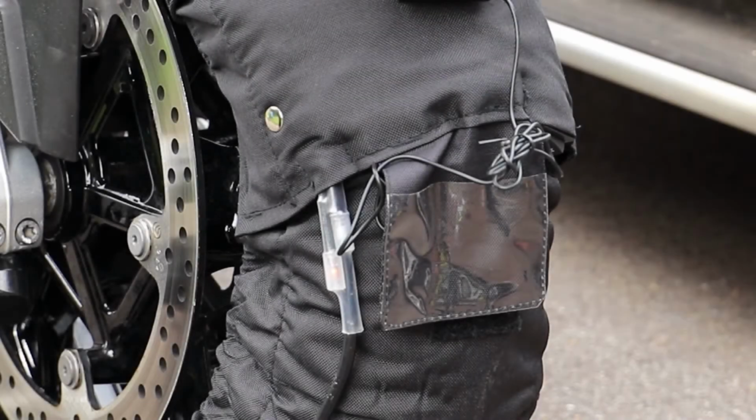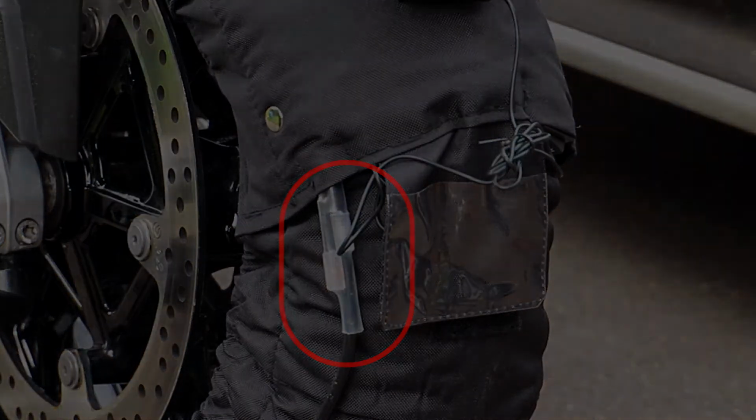In terms of operation, it's worth noting that where the cable connects into the tyre warmer, there are a couple of LEDs. Red indicates that power is on and heat is being applied, and green, of course, that power is off, meaning that the tyre should have reached its temperature. Of course, as the temperature drops back down, the warmer will switch back on again. Unfortunately, due to the bright sunshine, the LEDs are not really visible, but the left one here, the red, is actually on.